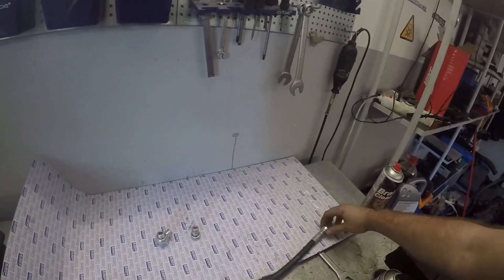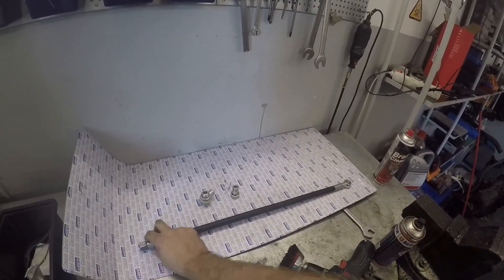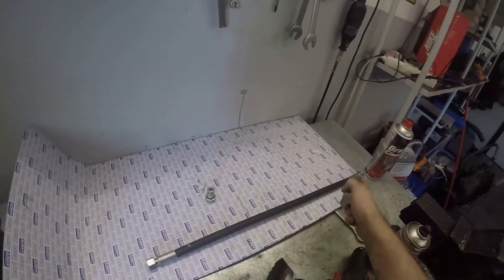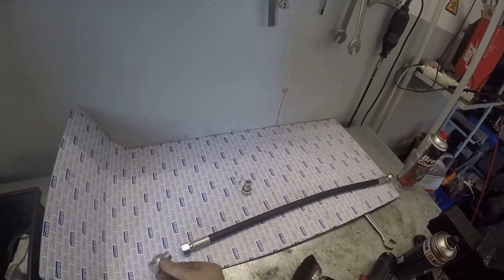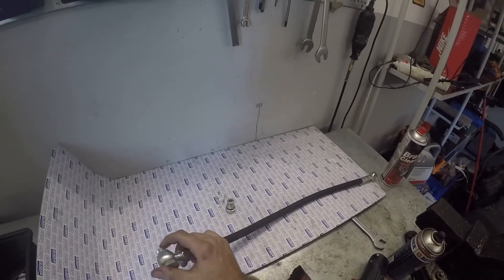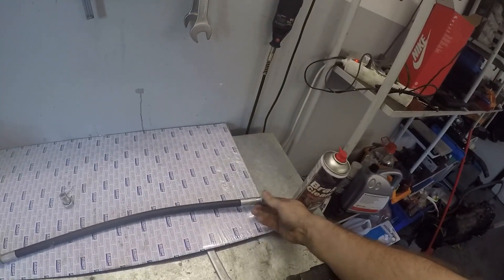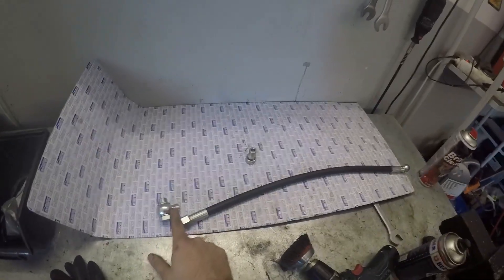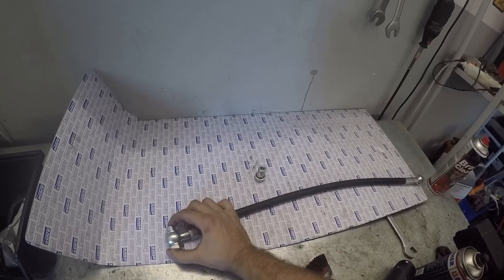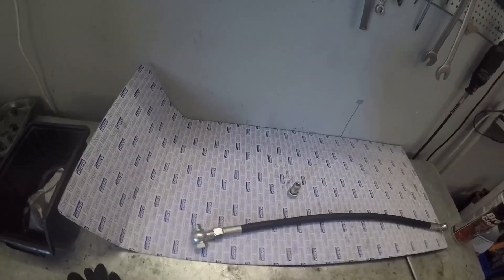You can have a hose with banjo fittings on both ends so it will lie flat to the block. I didn't want to remake this hose, so they gave me this adapter which screws in and basically creates a banjo fitting — it could be a banjo fitting straight up. Now I have an adapter, but that's fine. This should not interfere with the exhaust whatsoever.